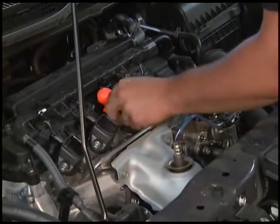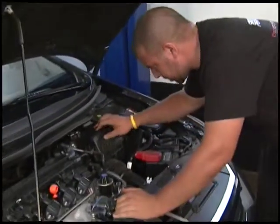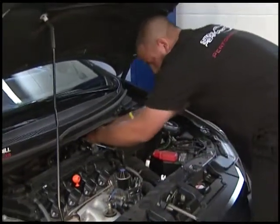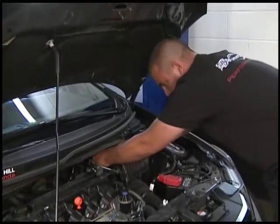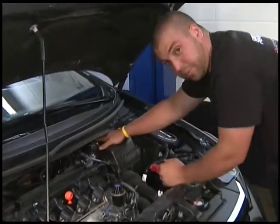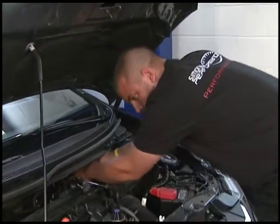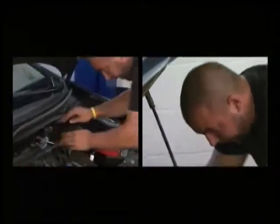The second problem — he's got an intake air temperature sensor circuit and mass airflow sensor circuit. So now we're going to find out what's happening on that section. We're going to check the mass airflow circuit here. If you actually look inside here, the connector has come loose. Someone was probably in here messing around with the air filter and simply forgot to put the connection back in. So I'm going to go ahead and snap it back in and make sure everything's tight in here — and it is.